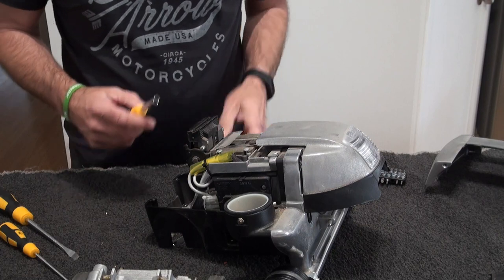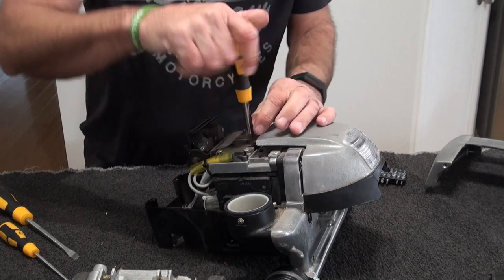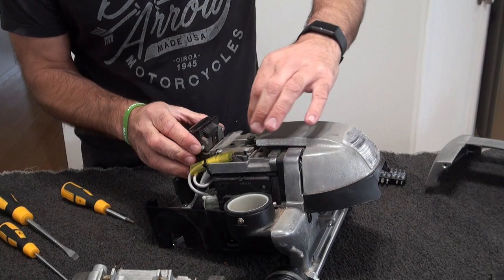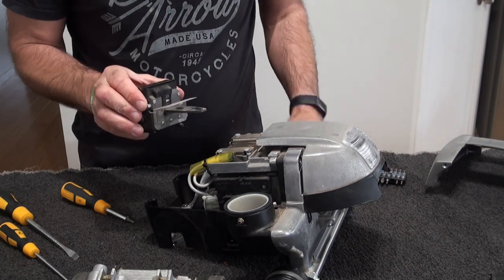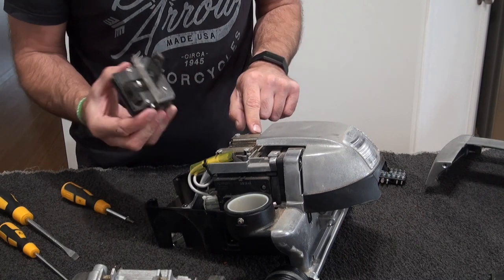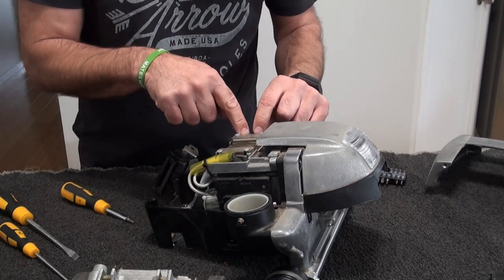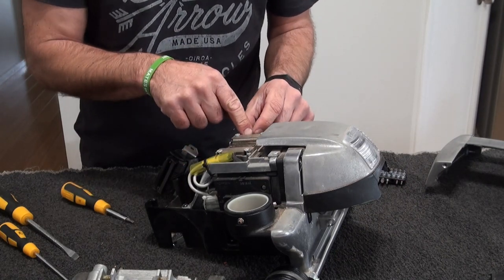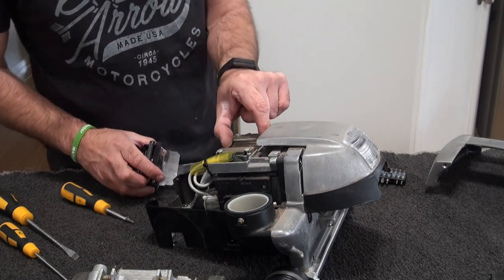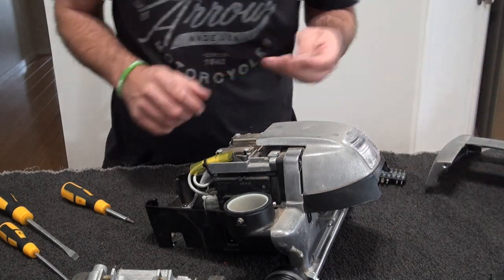Okay, so these are actually a Torx 20. Take that off. I mean, when you put it back on, you can see where the screws have been anyway, but normally it's about central. There shouldn't be too much movement. If there is a lot of movement in your tech drive, then all you do is undo these four screws. There's just a spacer block here. Tighten that block down, and then put it back on, and that will stop the over movement of the tech drive. So just put that there and put those screws with it.